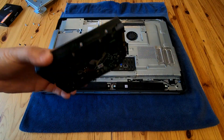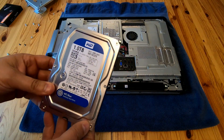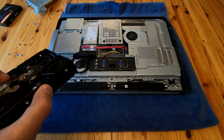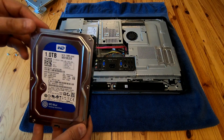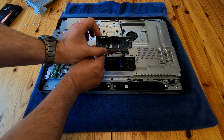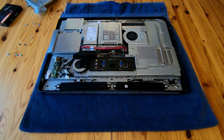That's where the drive goes. This is the drive that was in it — it's a Western Digital and it's broken with lots of bad sectors. A lot of the time manufacturers fit these because of price-to-capacity ratios. People compare numbers when buying — an SSD is significantly faster, about ten times faster, but if you see one terabyte versus 240 gigabytes, the one terabyte looks obviously better if you don't understand the technology. They put a mechanical drive in and after about four or five years these break.